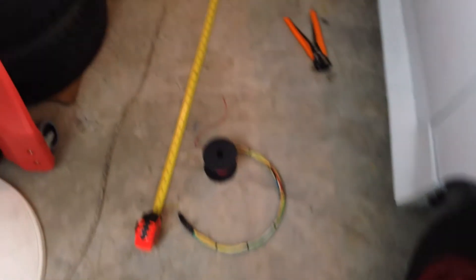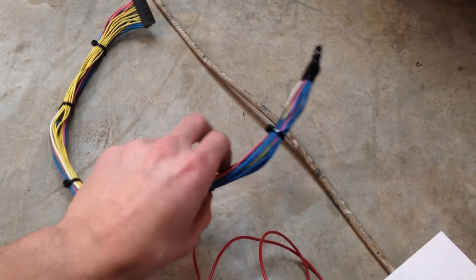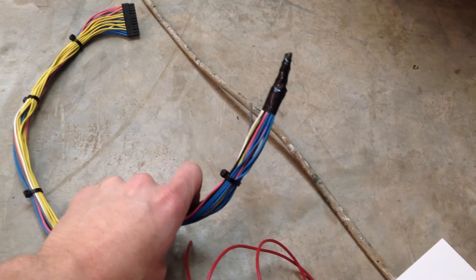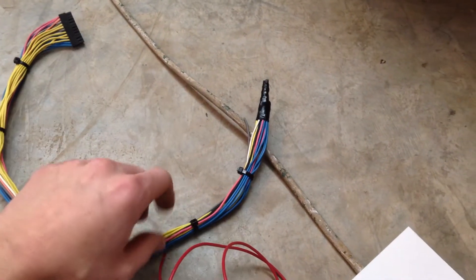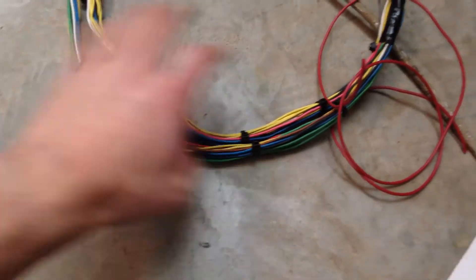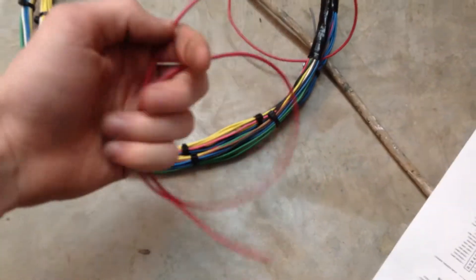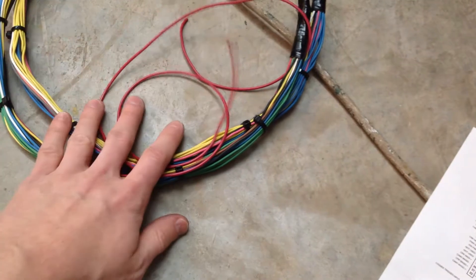What I'm getting ready to do is extend these wires so I have plenty of length to reroute them to where the ECU is. I'm not planning on extending all the ECU wires because that would be a pain — there are a lot more of those. With the FIC there are only about 14 wires involved. So I'm going to extend each wire I need on these pigtails, label them to make it easier, and then run them to the connections on the ECU.